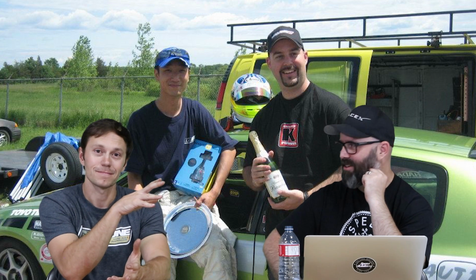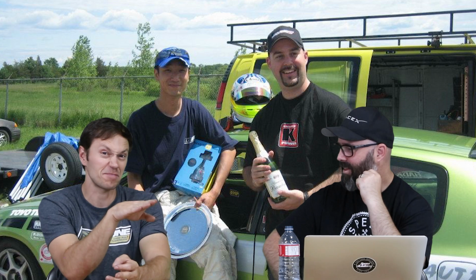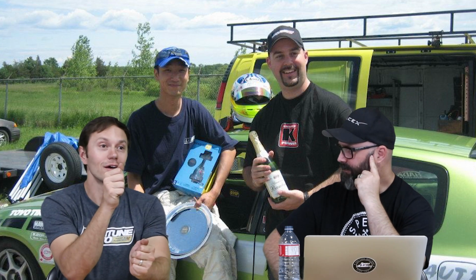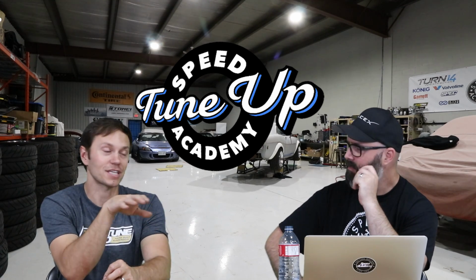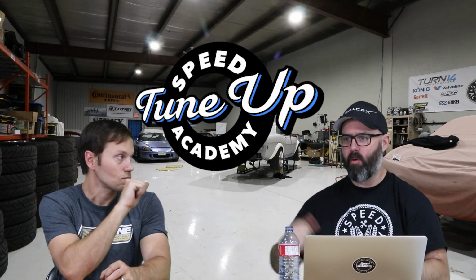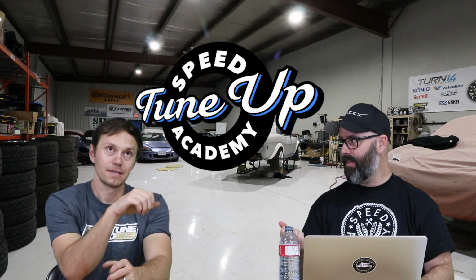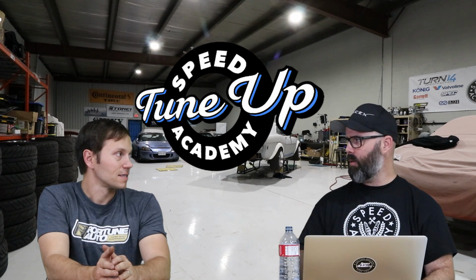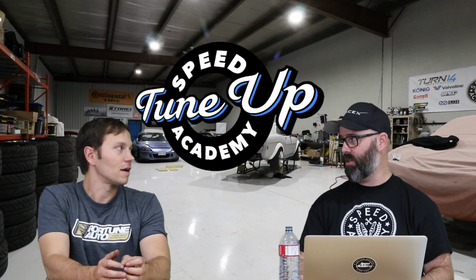No, it would start to drop gears. Like you would be in it 50%, 60%, 70%, 80% throttle, and it would not go. It was decelerating, even though you're giving it more gas. Yeah, it was super scary. And then it would drop gear. So we were in fourth gear, and it would just lose fourth gear completely. Suddenly, you only had third. And then we lost third. All we had was second while we were climbing out of Virginia into West Virginia, where it's super hilly. It's mountainous, really. The mountains in West Virginia are pretty epic.